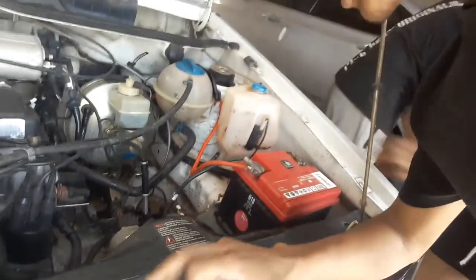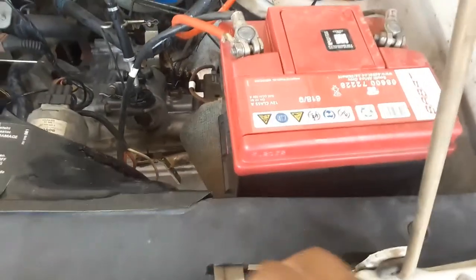Guys, the final update — did we succeed? Yeah bro, this thing is hard. Anyway guys, so we finally finished up with the car. We got the radiator in. It wasn't a complete straight fit — the top guard is not a direct fit for this bracket, so we had to modify it slightly to make it fit. But it still looks OEM, it still looks good.